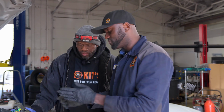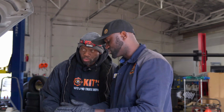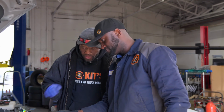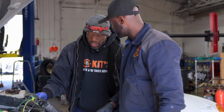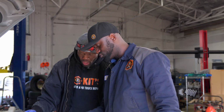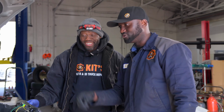So it's going faster, and then when it gets to the 4th cylinder, the starter has spun faster, so it has a lot of force and pushed that one all the way up. That's why this peak over here is higher on cylinder 4. If we restore the compression on cylinder 3, they're all going to even out. Does that make sense? Yes, it does. So 1, 3, 4, 2. We have a dead cylinder. Number 3 is dead. We have low compression in cylinder 3.